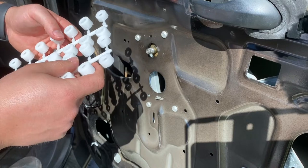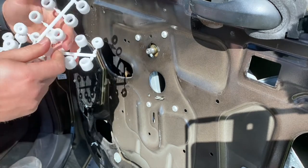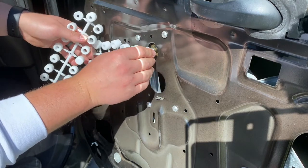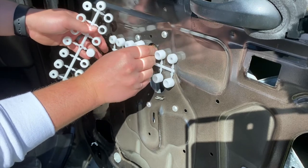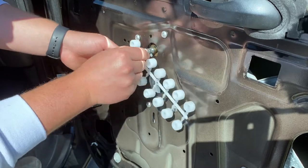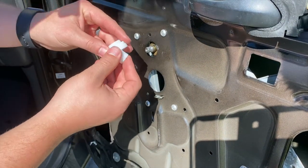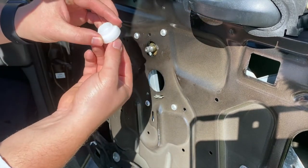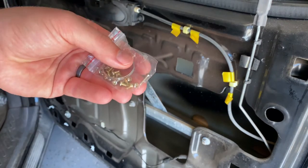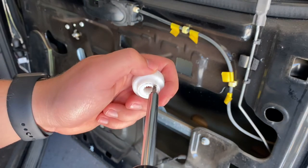I'm not showing the actual door panel removal — that's going to vary widely for the audience. Just keep in mind that if you're having any resistance, double check to make sure that there's not a hidden screw or tab keeping that on there. After the door panel is off, you're going to have these little adapter grommets that are going to fit over the stud where your window crank used to be. Just find which one fits over the best — in my case it was the third one. I did go ahead and cycle through all of them just to make sure that was the best one. Find out which one works for you and remove that one from each of these two assemblies. There's a larger outer grommet gear as well that the smaller adapter one is going to fit into. Pick the one that basically fits over your existing stud thread the best and line up these two notches. Then find the two longer screws that are in this set — they're going to be different than the others — and thread that into that notch. Be careful because it seems like they are going to want to strip pretty easily.